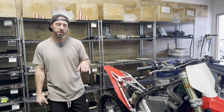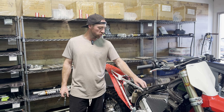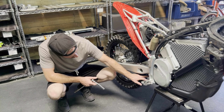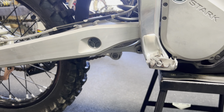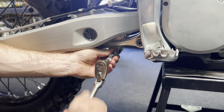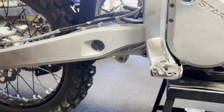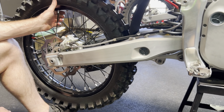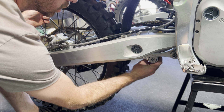My tip is to first remove the bottom bolt so that way the swing arm will become free of the shock but the shock will still be held in place by the top bolt. We've got a 13 millimeter nut on this side and that's going to be the first one we remove. With my foot underneath the wheel I'm able to apply some pressure to take pressure off of this bolt, and by wiggling up and down quickly I can easily push this shock bolt out.